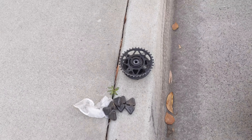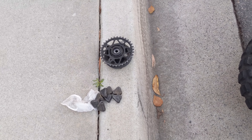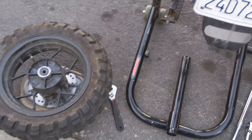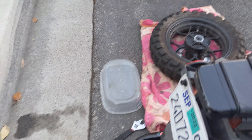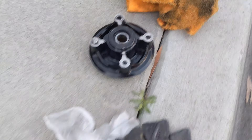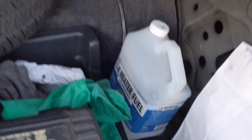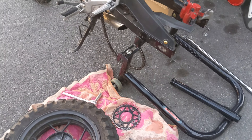Take this off. There should be a washer on one of those sides — I think it's in there. Make sure everything comes in and off as it's supposed to. I'm gonna clean all this up with some kerosene. Those are the dampers I was talking about replacing. My bike has about 8,000 miles on it. A lot of people will mix these up and put them like this — that is definitely not the right way; you can tell they don't even want to fit that way. They go over the hump, and the raised side goes over that hump. These are already out, so might as well replace them with the new ones. I'm gonna use two nuts to tighten everything in with some red loctite, and clean this whole thing up with kerosene.